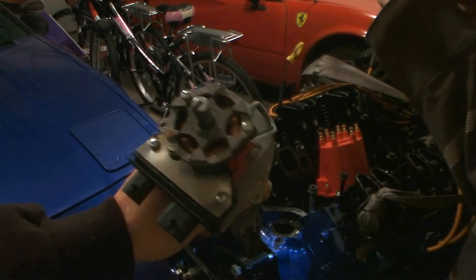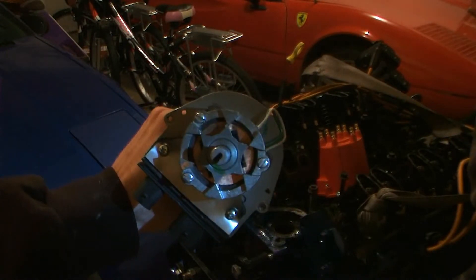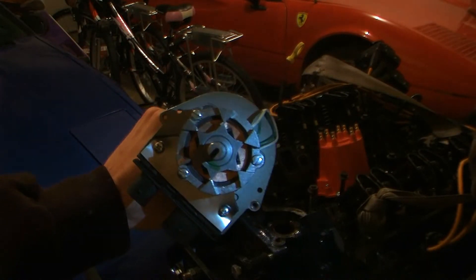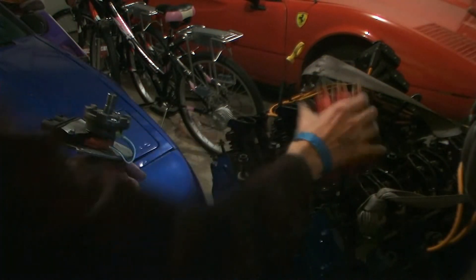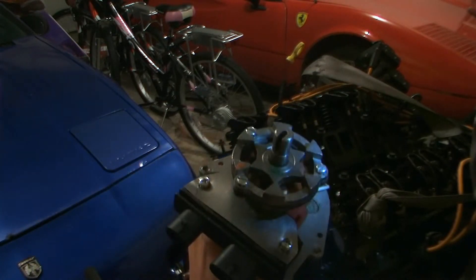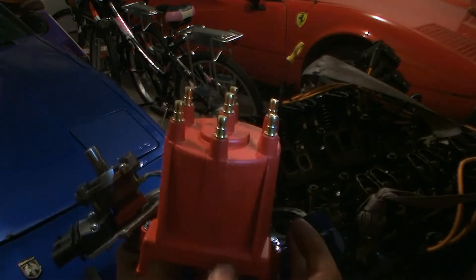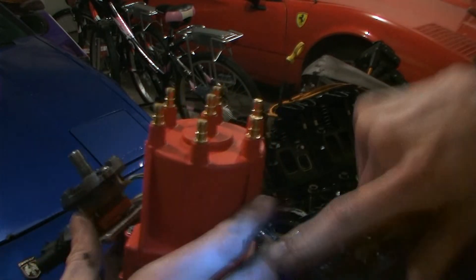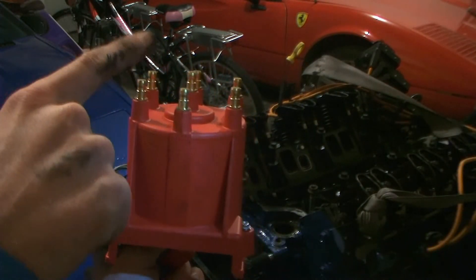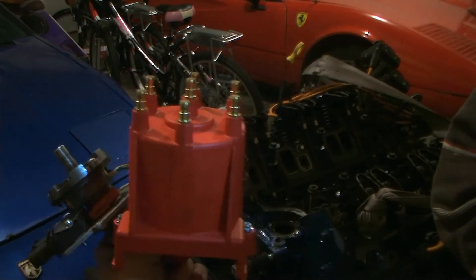This is an A1 Cardone — it has a better and more updated coil. What we're going to do is point the distributor rotor towards cylinder number one. Cylinder number one on the cap is this one on the left. From the flat point on the cap, the point on the left is cylinder number one.